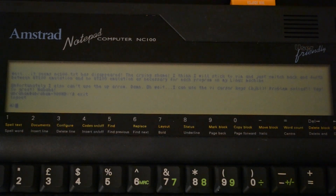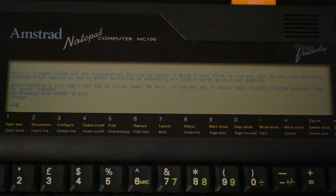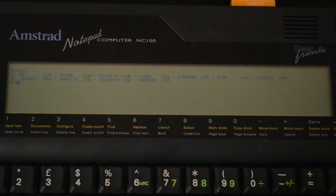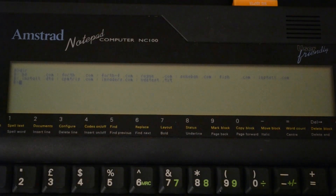So I'll stop for now showing you some system utilities — VDE and Qterm. In a second I'll show you just a few delightful CPM games. Now I've switched over to the B drive. One other thing to mention about drives: right after you've started up CPM you need to format your RAM card with however many logical drives are supportable given that RAM size. For a 1MB SRAM card you can do 4 drives — format A, B, C, D. If you had 512K it would be A and B, and 256K just A.